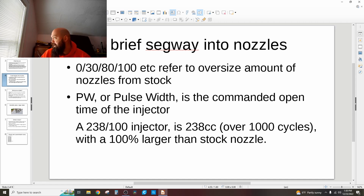Another thing you'll see people refer to is pulse width — the commanded open time of the injector, measured in milliseconds. From what I understand reading about tuners and people who tune these, at a commanded pulse width of about 3ms you're limited by the amount of time you have to spray the injector. You can command a longer pulse width, but you only have so much time for the piston stroke. On a Power Stroke 7.3, that winds up being about 3 milliseconds.